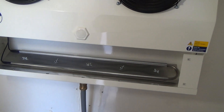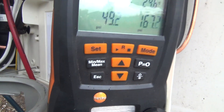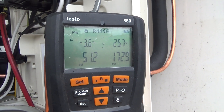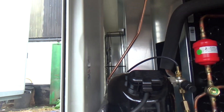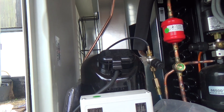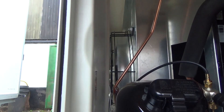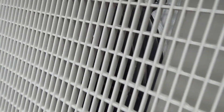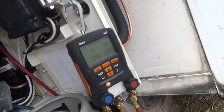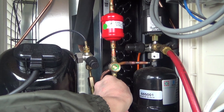Let's go and see what the compressor's doing. Compressor's on. I've put minimum fan speed control on — I've put minimum speed ones on these before and they've still not been slowing up in the winter. There we go — just come up to 200 psi, just started moving. So that's a condensing temp of around 34°C, probably about right. There's a bit of heat in there — full sight glass. We've put 1.3 kilos in, I think. Let's go with that.